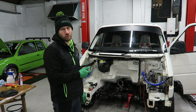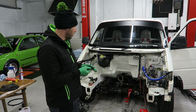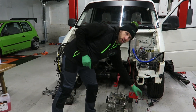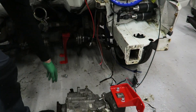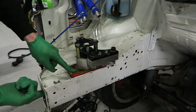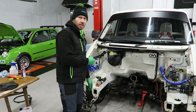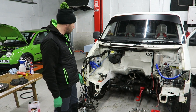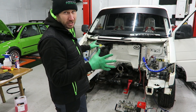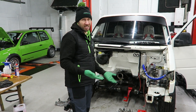The really cool thing is we're fitting the SpeedingTube T4 conversion kit that Tom's developed with a lot of top companies. He's done a really good job and it allows the 18T with the O2M gearbox to go straight into the T4 — obviously with custom gearbox brackets, stabiliser bracket, and a really nifty engine mounting bracket which includes a captive plate to go underneath. That's really good because it uses the strength from the chassis leg to support the engine, just like it is in the car — a bit of a pendulum setup. This kit allows this engine to go into this van even in standard form.